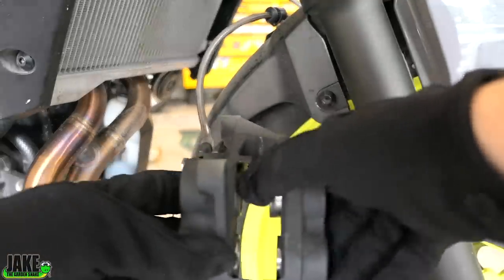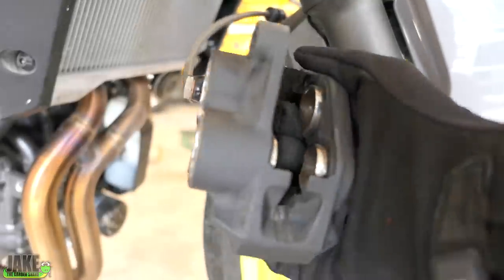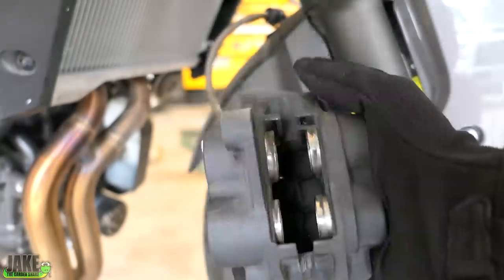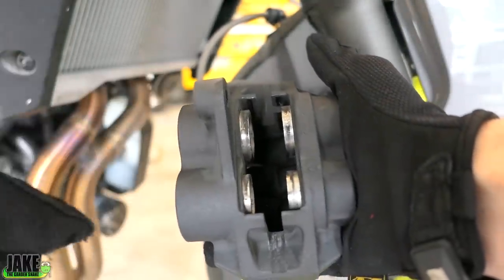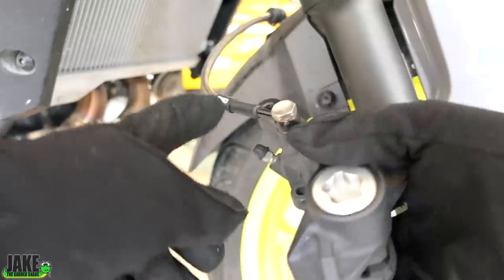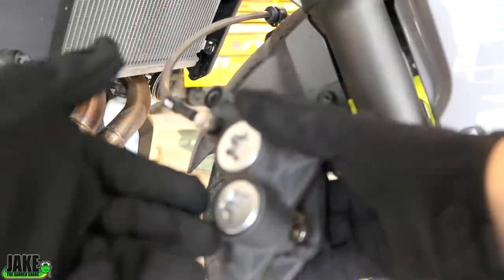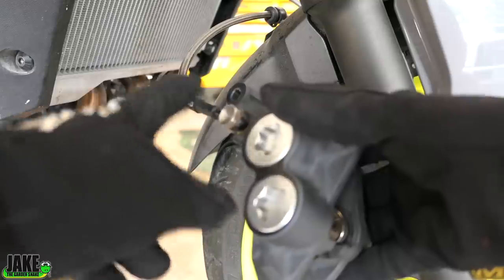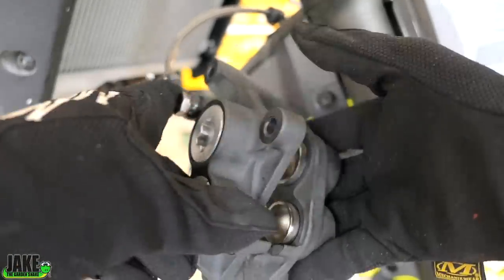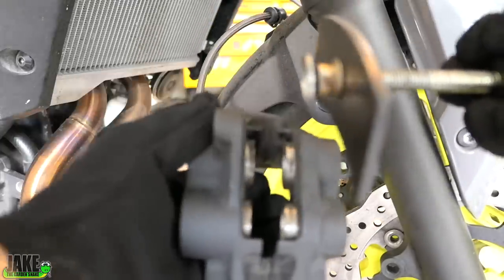See how that one's out and that one's up? You've got to kind of press them all at once. I'm going to try to evenly make them expand out a little bit here so I can demonstrate. This is more like what you would see if your brakes were a little bit worn down. If you've topped off your brake fluid there's probably going to be a little bit too much fluid in the system, in which case you could crack this and bleed a little bit out. Now you're probably going to have to re-bleed your brakes. There's some really cool tools but you could just do it by hand — there's just a small bit of air in there. As far as pressing them back, there are some automotive tools but they normally don't work super well for this application.